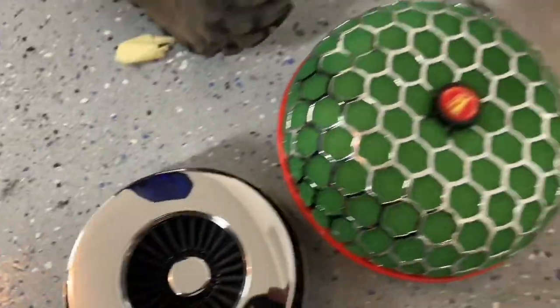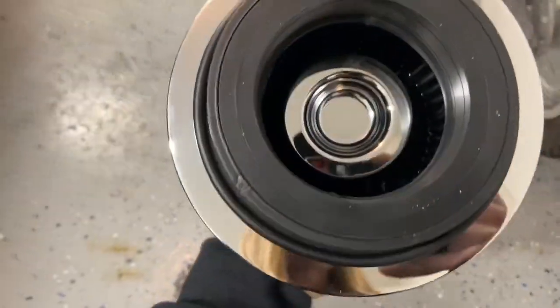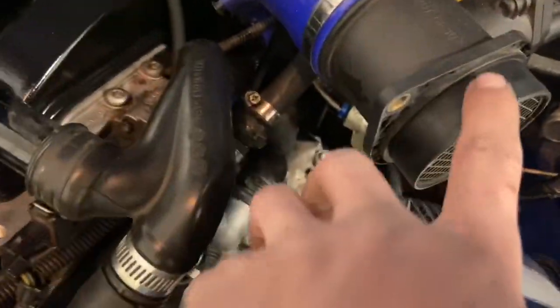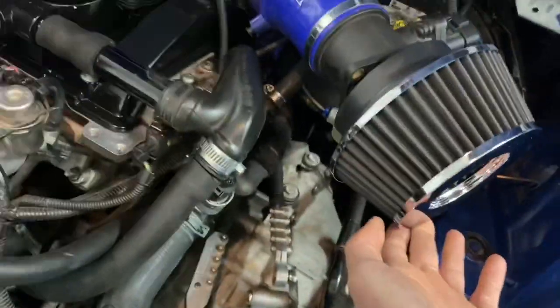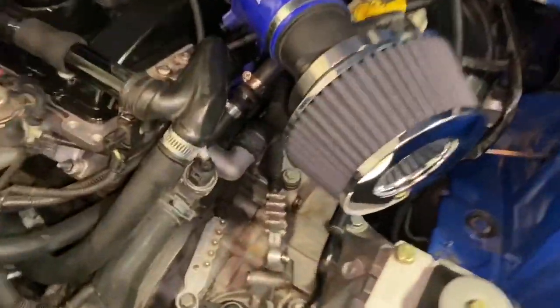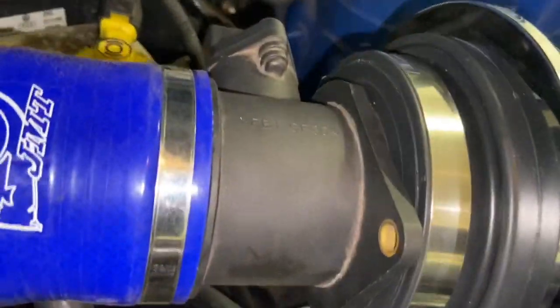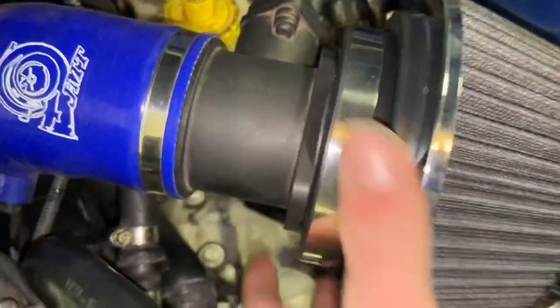It's smaller than the green one — way smaller. Smaller is better. But this hole is three inch and my MAF is two and three quarters, so I'm going to take the MAF off and wrap black tape around this edge so that it fits nice. It's gonna look so good in there. There it is — I taped this lip inside of here with nice black tape, didn't take much, but now it fits really good.